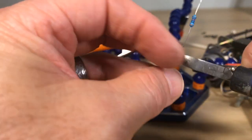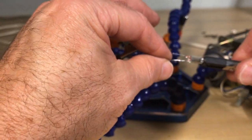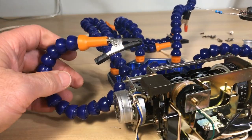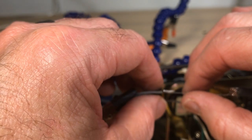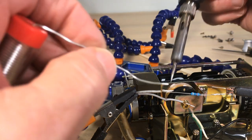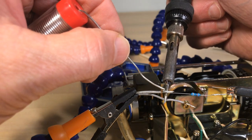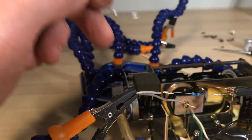We'll check this against the old one to make sure the length's the same, and we'll probably trim back the resistor side just a little bit — about a centimeter. It doesn't matter what side the resistor is on, the position, or the distance away from the bulb. There is no positive or negative on these leads — it's alternating current. Now when you get the wires connected up here, since it's still attached to the clock, you have to make sure you move this away from the clock. Don't get in a hurry — you drip that solder down on your towels and you're going to regret that. Get your wires warm. This is good quality wire — lesser quality wire the insulation will draw back with the heat. This is military spec wire in here.